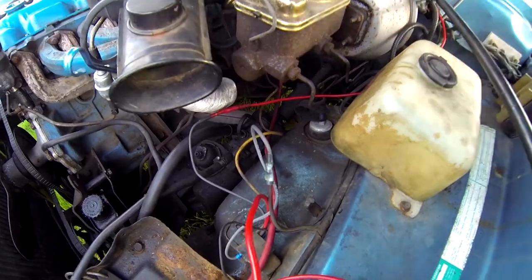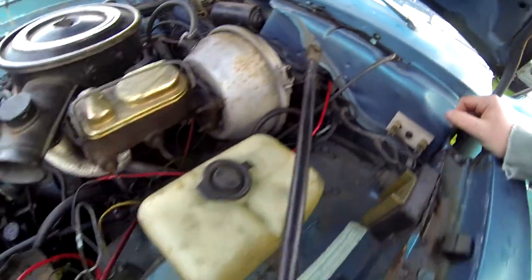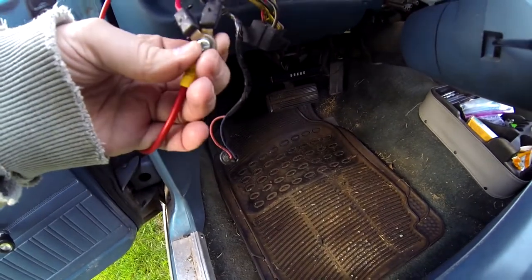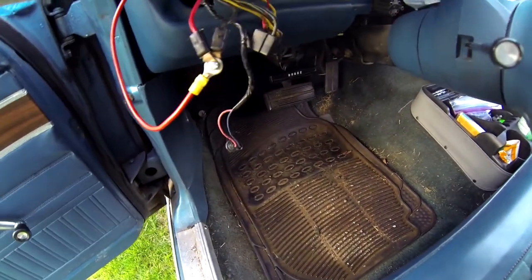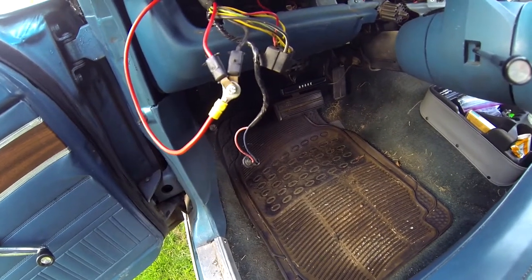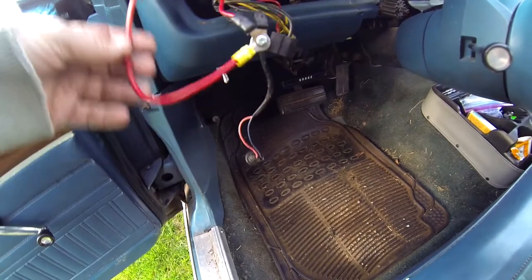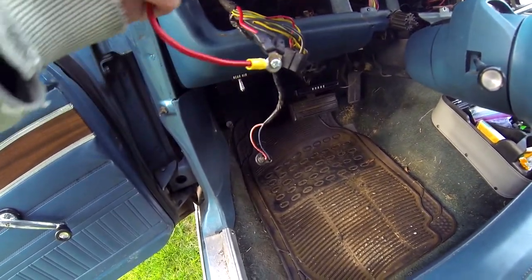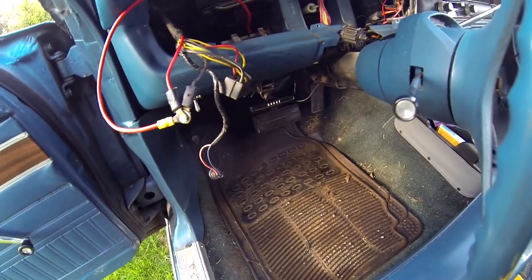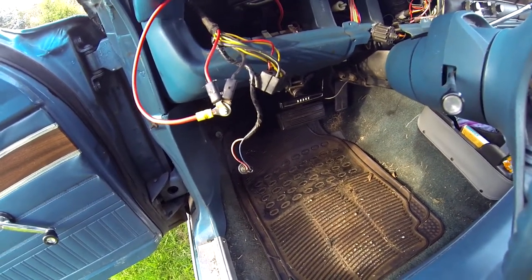This is the bypass method — the Chrysler fix for the wires melting down at the bulkhead connector. I'm just about ready. This is a little rough, but I want to get it all connected together just to make sure I've got electrical at all — headlights and low voltage stuff — and then I'll tidy it up later. This little bridge basically takes the two wires that were off the back of the ammeter and merges them with the wire I put through the firewall. Even when I put the dash back in, it's not gonna be final — just making sure I've successfully routed around whatever was burning.